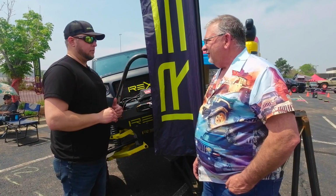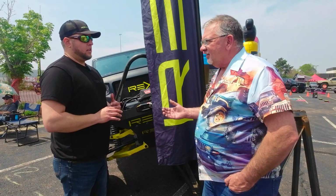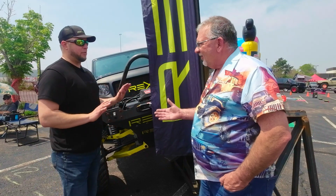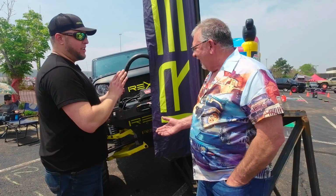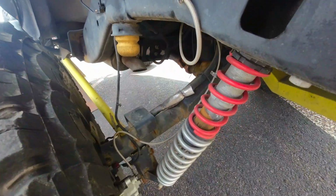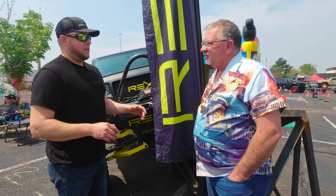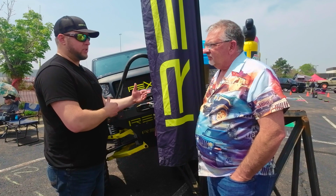I mean, it's going to make this like an off-road, high speed, and still very capable, slow rock crawling rig. So is it essentially IFS? So it is, yeah, it is completely IFS in the front. So it's 100% IFS. That's what it looks like. And in the rear, it reuses your existing Dana 44 axle. Okay. We put a truss on and some new suspension members, but overall, it's just kind of a new kit for the back, but you reuse that portion.